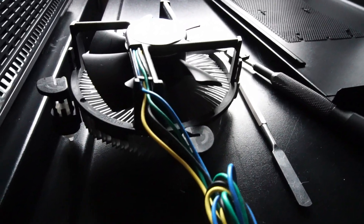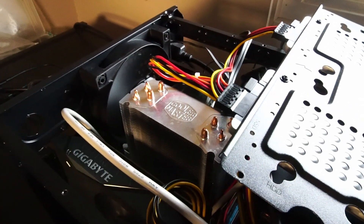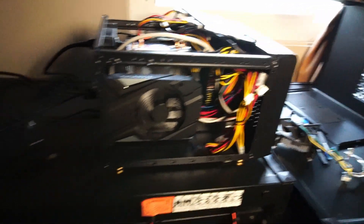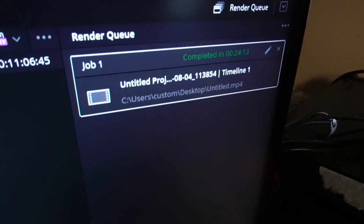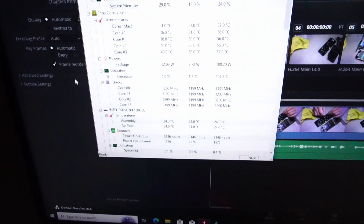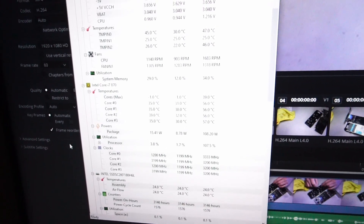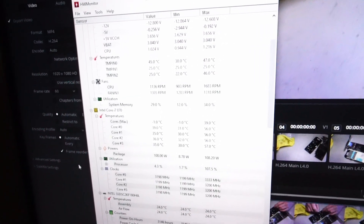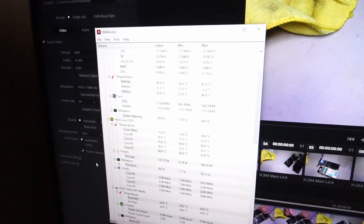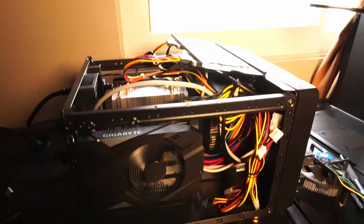Don't feel bad, little stock cooler, I know you're trying your best. One nice thing to note is that it's also substantially quieter. The tower cooler definitely worked — we got through an entire render, and it took 24 minutes and 13 seconds. Judging by the low CPU temps, maybe the stock cooler wasn't mounted properly; it felt tight to the motherboard, but maybe something was a little off, because I wasn't expecting it to crash. Anyway, let's put this thing back together.